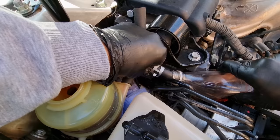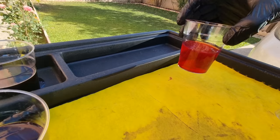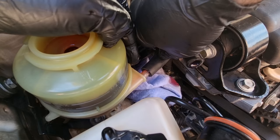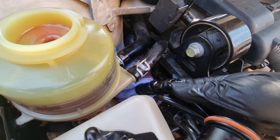Just for experimental purposes, I'm going to take the bottle out and put in a clear cup so I can see how clean the fluid is and compare it with the old one. The return line fluid should be the same as the new fluid in the bottle — they are slightly different due to air bubbles, but that's what a complete flush should look like. This is the old fluid — what a big difference! Next, put the return line back quickly and put a rag under the hose. Now steer the wheel lock to lock to release all the trapped air before starting the engine.